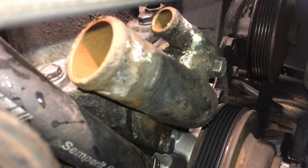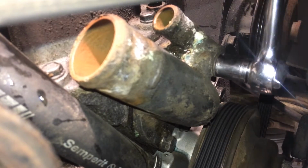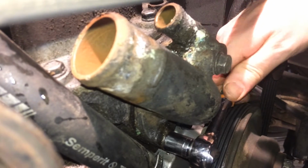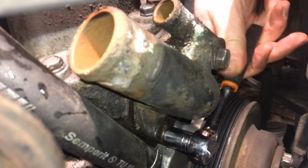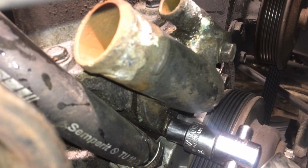These are the two bolts that we're talking about. This is the top one, and it's a 1/2 inch socket. Let's see the other one. This one down here. You need one of these small wrenches, because otherwise, oh, that one's tough. The previous mechanic has definitely tightened this one too hard. You only want to torque these to 13 or 14 foot-pounds, or 17 Newton meters. That's about the torque according to the instruction manual. Yeah, this one was sitting very tough. I extended the shaft, and now it seems to give.